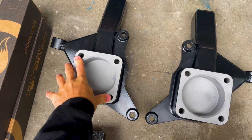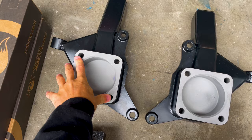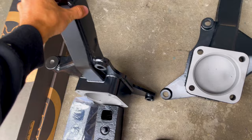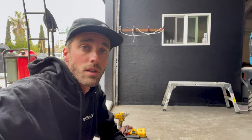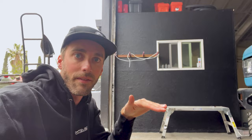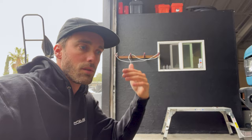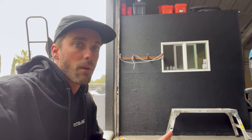These spindles will completely replace the spindles that are currently on the van. The beauty of these is that they use the factory measurements for your normal spindle, but what they've done is taken the hub location and just moved it three inches down. So the factory control arm angle stays completely factory — as the engineers intended — the best possible control arm angle for the van. It uses the proper amount of travel on the shock and just keeps the factory ride, which is something I really wanted to get back to.